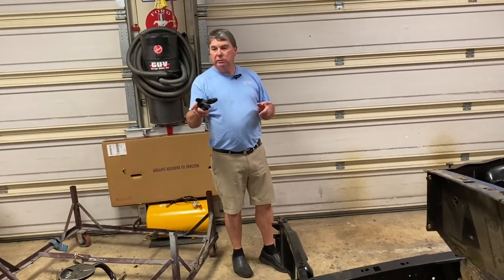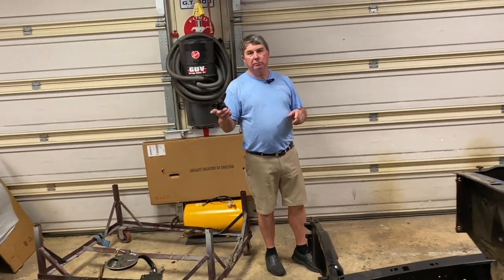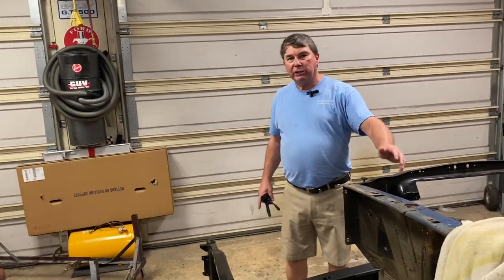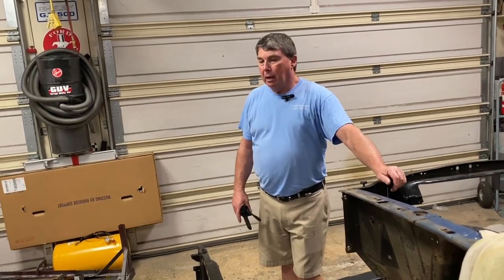we're going to be getting the engine torn down completely, get it to the machine shop, let them look at it. They'll probably want to reestablish the crosshatch in the cylinder bores. I'll let them go through the heads. They'll probably do a valve job just to clean it up. Then we'll order some parts, rings, bearings, gasket set, for example. I ordered a cam, and we'll get the engine put back together and painted, and I'll put a bag over it, and I'll save it for that magic moment when I want to put the engine back in this car.